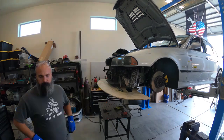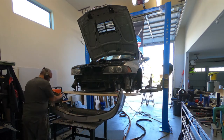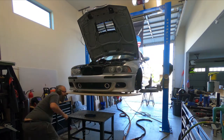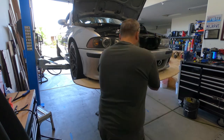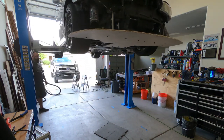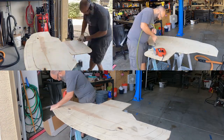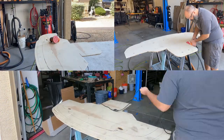I like to preheat dissimilar metals mainly to not have to put so much heat into the thin stuff on top — tends to work out. And here goes the on and off of the bumper as I was getting the actual height set of the splitter. I had to trim and trim, and I think ultimately when I fiberglass the gap on the bottom, I'll wind up cutting all that bottom of the bumper out and just starting fresh. Here I used a 2x4 template cut down to four and a half inches, which will be the distance from the base of the bumper that I'm going to trim down to my finish size. Trim, trim, cut, router, sand, cut, router, trim — until I got it to a point where I felt it was acceptable.